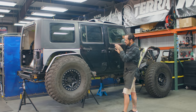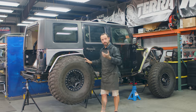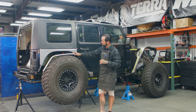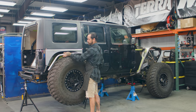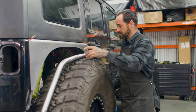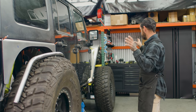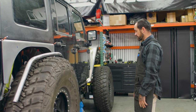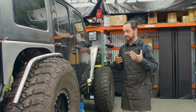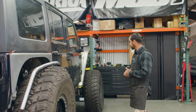We built the shock tower in there — it's all inch and a half 120-wall chrome moly, same as the front. It doesn't need really big stuff; there's a lot of tubing and it's all in the right places. I had the fender up here which we can get into. But right now I want to look at the sheet metal. It's really been a Colin job — just like with Sean and Colin, both have put huge time into this thing. It's been a labor of love for the shop. This truck escalated into more work than we anticipated, but it's a beautiful piece.